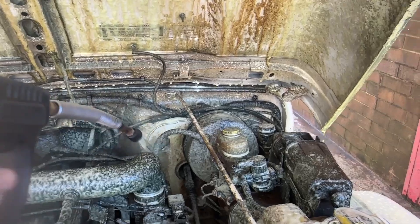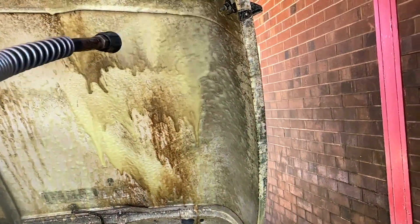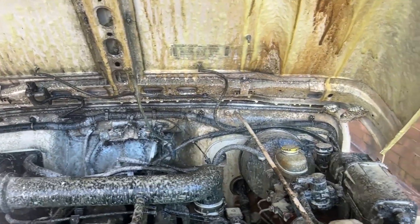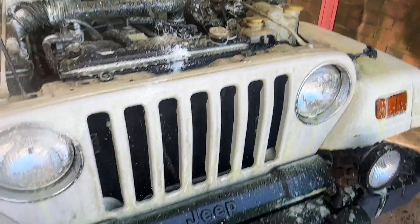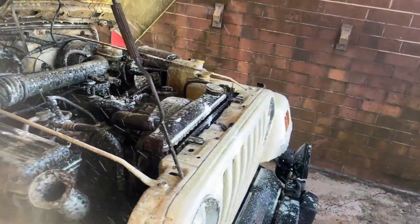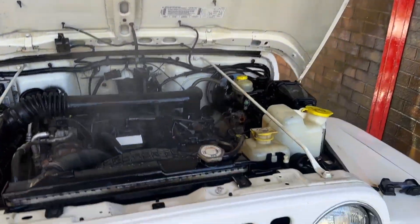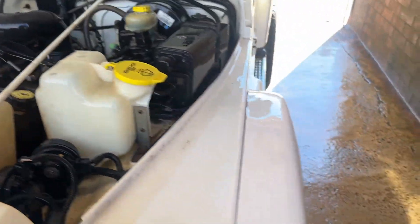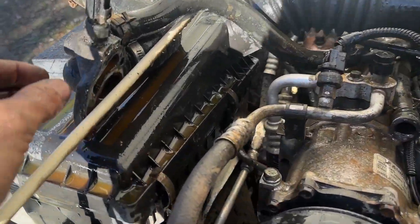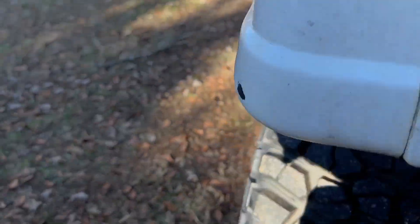It's a water pump and all in here — this thing ain't got no heat in it. I'm gonna service it, but I figured before I even start on it I'd clean the crunchy things up. It's got a look better than it does — it's been sitting a long time. I was working on this thing and decided let's go ahead and flush the heater core while we're at it. Look at the stuff coming out of this heater core from sitting.